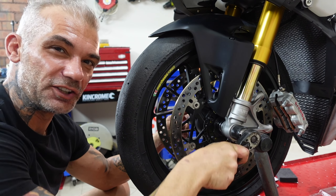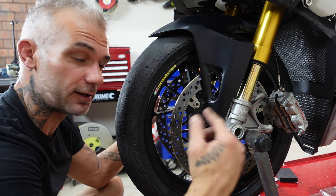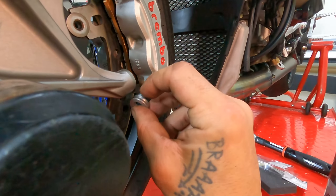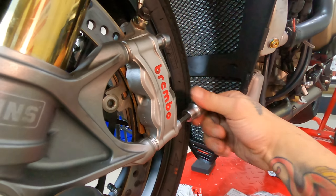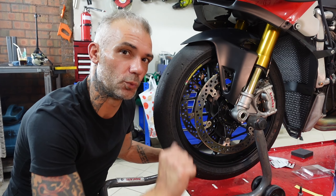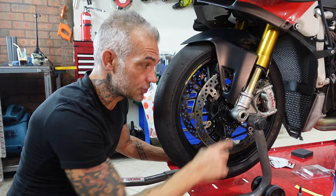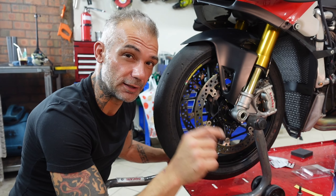Tighten until the other side starts spinning. We're doing that to bring the axle, forks, and everything straight. Put the calipers on so they're not playing around but don't fully tighten yet. There's an important reason why we hand-tightened the calipers for now — we'll come back to that. Finishing with the wheel, the nut is still spinning. We go ahead and torque the two screws under the boot of the fork — use a torque wrench, quite important: 19 Newton-meters for that one.